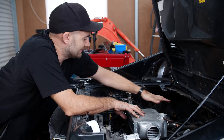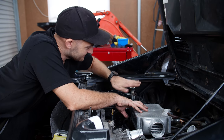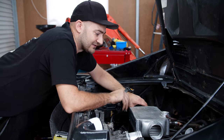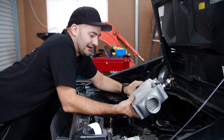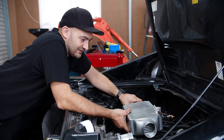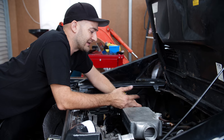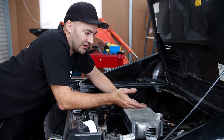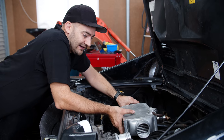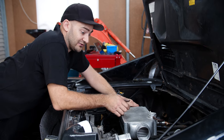You've got a fair bit of space over here, particularly in this area where it's quite cool and you're not near the hot exhaust housing of the turbo. There are triangular ones where it uses that whole space — air out of the turbo on this side and then straight back out that way, which is by far the neatest way to do this. Being that I'm recycling parts, I have to be a little bit more creative about where I put it and use silicones to make it work. I think this location is actually going to work the best. I've got to do it with a loop to get back to the turbo, but I don't want to clock the factory turbo — partly because it's a pain to get it off, and partly because it gives you options if you ever want to put an air-to-air intercooler on this. You can just bolt it straight in and everything's in the right place. Rather than mess up that whole setup, I can just use a $10 silicone to make it do what I want.